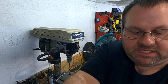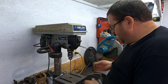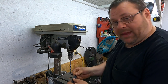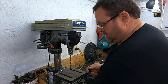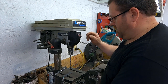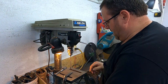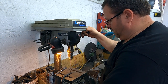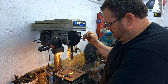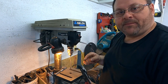I'm going to drop you down so you can see exactly what's about to happen. If I'm doubling it, I'll put this in the chop saw, cut the length I need, mark where I want the hole in the end, then double it and tape it up in the middle. Then I put it in the drill press and hold it with some pliers. Watch how easy this is — just apply pressure and that carbide tip goes right through it, right through spring steel.